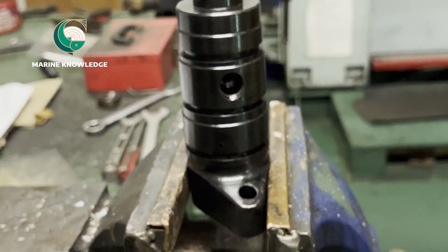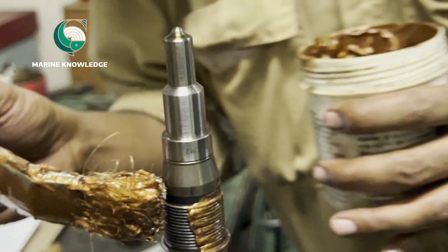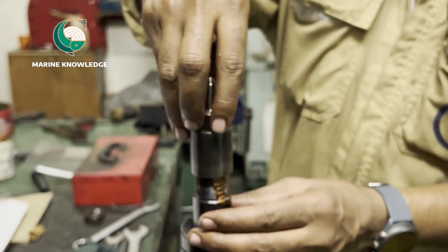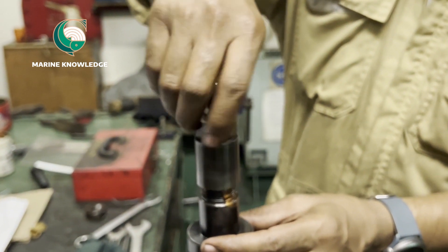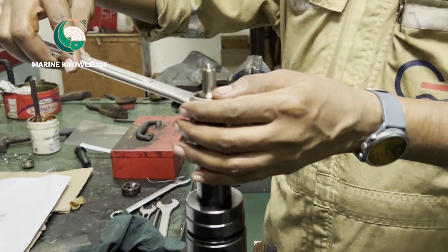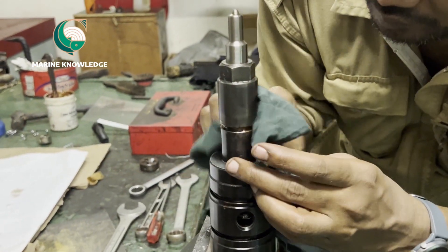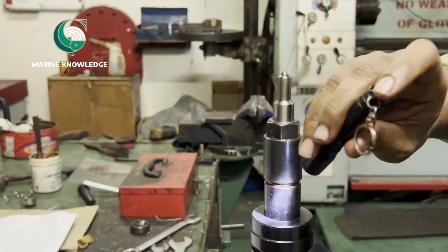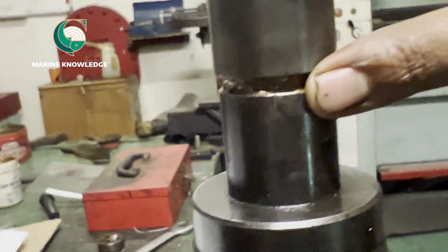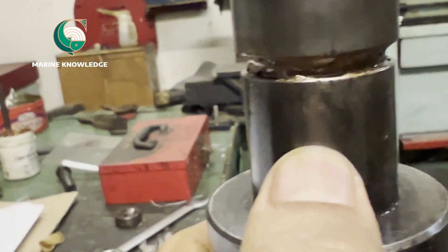Give a slight coat and then fix the retaining nut. When tightening the retaining nut, you have to use the correct torque range, because if you tighten it too much it may affect the needle valve and cause it to get stuck. You can see there is a punch mark already made to ensure the matching of the retaining nut and body, but don't always trust the punch mark — always trust your torque.